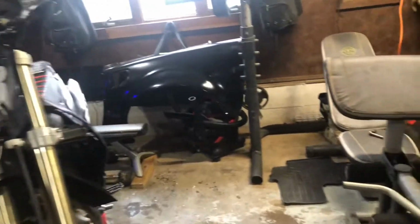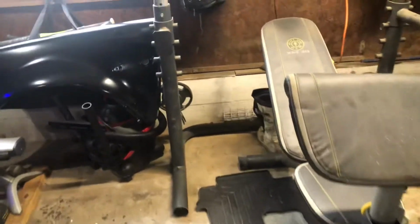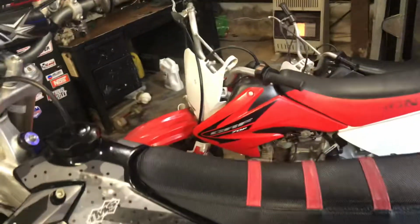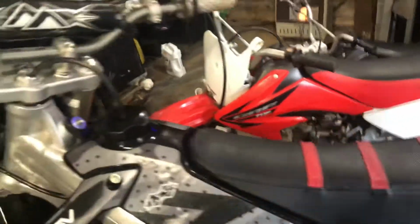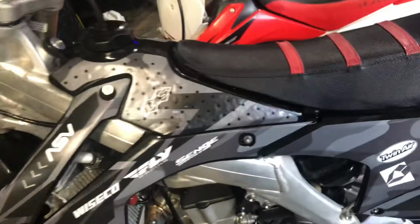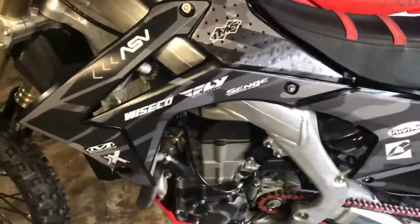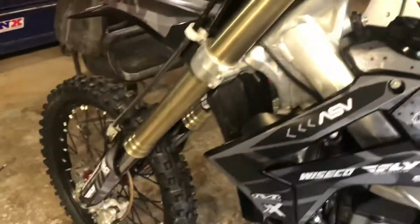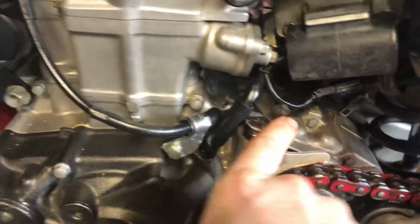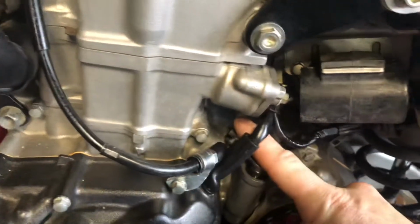So I did some research, and everybody was talking about using a 2015 part or whatever, but nobody ever actually did it that I could find. I'm sure people have done it, but what I did, I bought a 2015 cable, a 2015 bracket, and bought another clutch armature, which I don't know what I did with, but it's laying here. Basically, I just cut it off right here and re-welded it. Instead of it pointing back this way, it's pointing this way now.